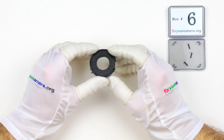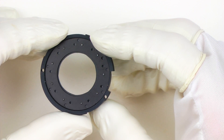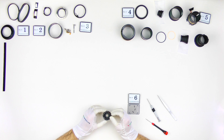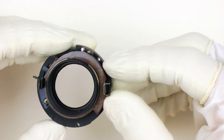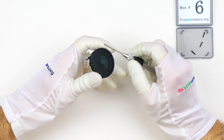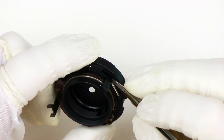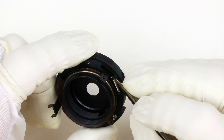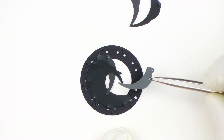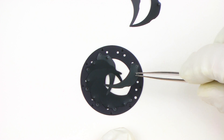Now let's take a look at the diaphragm assembly. It looks good, kinda old school, but there is one part I don't like right away — this manual adjustment ring. Diaphragm assemblies are not always easy to put back together, especially if you have completely no experience with them. With this one, judging by its construction, it might be necessary to adjust it after reassembly, but you can do it at home using just your camera body, getting it accurate within one third of a stop. However, if you don't absolutely have to disassemble it, don't — save yourself some trouble.